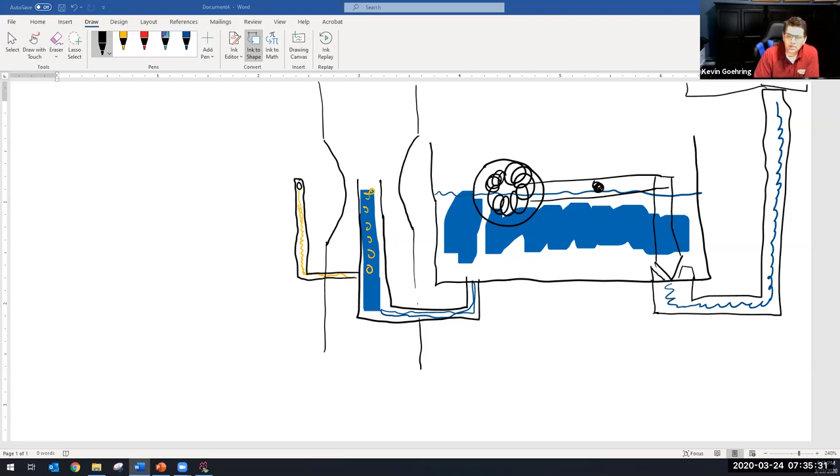To do that, we drill a passage off of the side here, run this little passage over here, and put a little hole up here in the top. Now, that hole has to be higher than the fuel level. If it's not, then when the engine's not running, there's no air in here — it actually fills up full of fuel because everything's static. There's no suction.